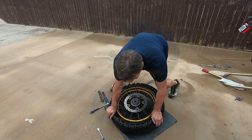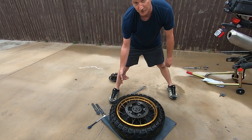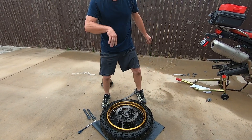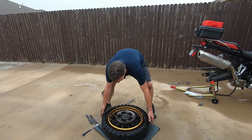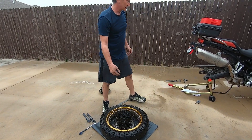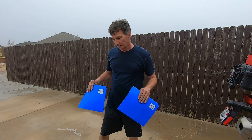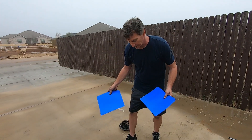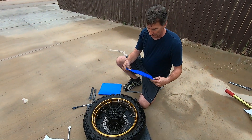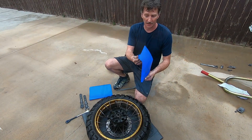This side took maybe going around about three-quarters of the way for it to pop. Here's another little trick I use: I normally have pieces cut out of an old plastic jug or something like that to keep you from scratching your rim as you break the tire down. So I went to Walmart and bought 30-cent plastic binders.